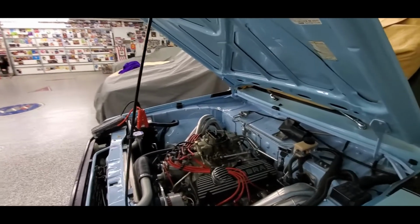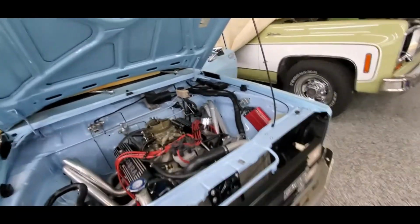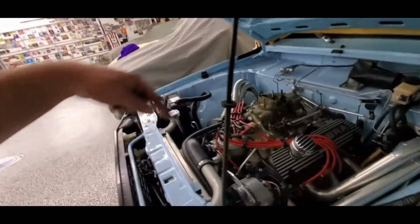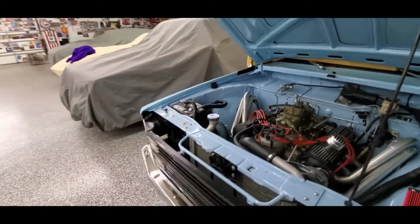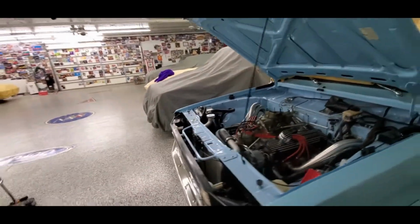There, okay. You can't hear me anymore because this thing is loud. We had a weird little scare, so hopefully we got that fixed. I'll be checking. But fuel started leaking here out of that cleanable fuel filter. It must have backed off enough that fuel was piling up on top of the water pump timing cover plate. So go ahead and start her.